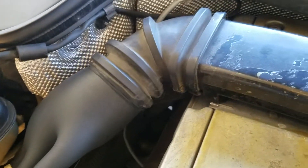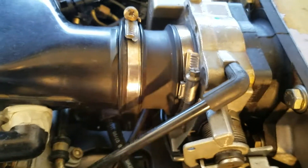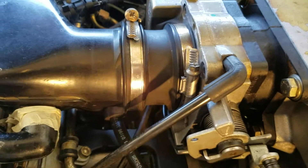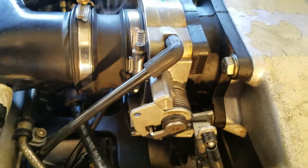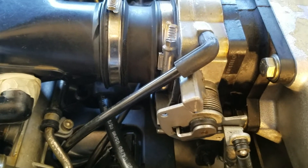Getting a little bit of leak coming out of the glove, the large shop glove. That's normal because it's not completely sealed. Let's look for leaks. There's number one — I'm getting a lot of smoke coming off of there. This is the boot that attaches the snake to the throttle body, and that's leaking like a sieve.